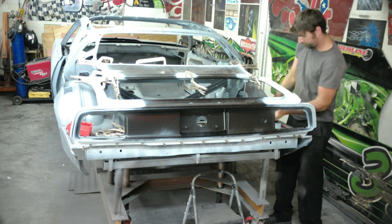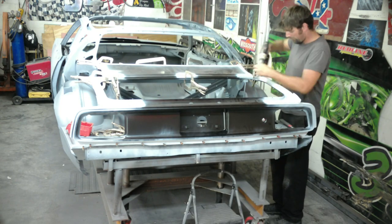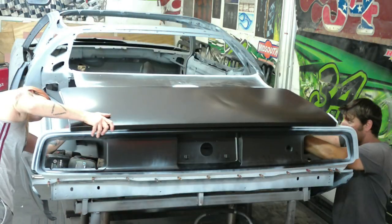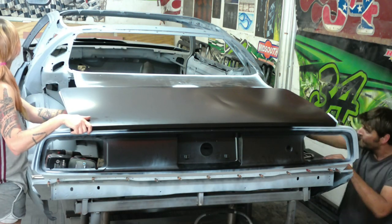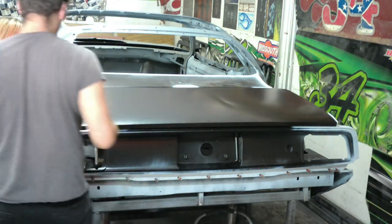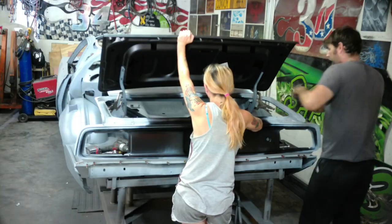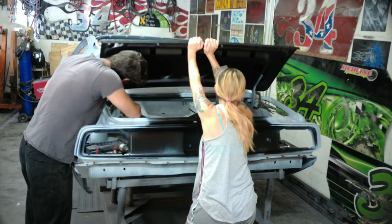The key here is do not weld anything. It might look good, you might think a part's going to be fine, but then you go put a quarter panel on and realize everything's thrown off. This is the first time the trunk went on the car. You can see there's a giant dent in it — we have to fix that. When we got the trunk the box looked fine, but two weeks later — big surprise dent in it. So I'll have to fix this dent, but not a big deal. We went ahead and put the trunk on just to make sure everything is going to work before spending time fixing the dent.